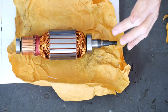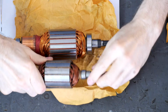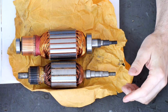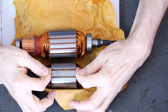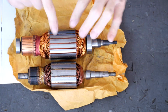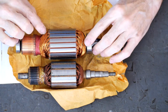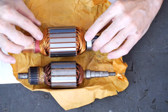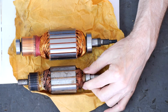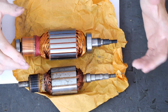Here's the 65A, the 1965 to 1981. You can see it's shorter, with less meat. What's important is the amount of metal here. The fact that this has more metal tells you there's more wire length to make the electricity, so this one should come up at a lower RPM, as well as being wound differently. The wires look heavier in this compared to these wires. Of course, this could be aftermarket, there's no telling. Those 6 that I bought seem to have different wire gauges, and if it's a 6 volt, it might have a different wire gauge. But this looks really, really well made.